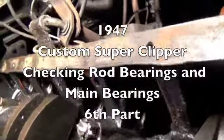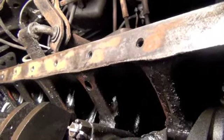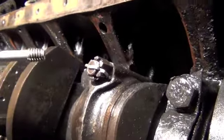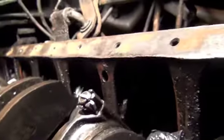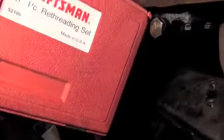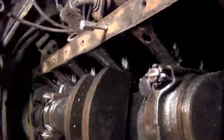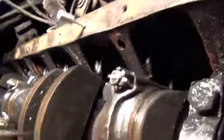Now let's move on with the cleanup of the bottom of the engine so we can get the pan back on. I picked up what I call thread chasers — they're not as sharp and don't cut like taps. These are Craftsman; they call them a re-threading set. Sometimes it's hard to find stuff because if you call it one thing they have it labeled as another.